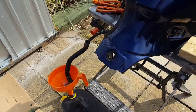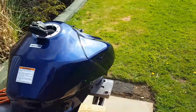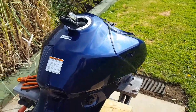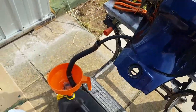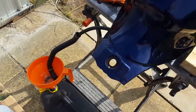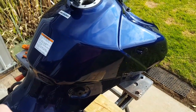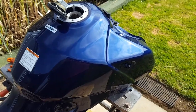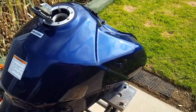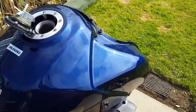Hello Springer Beck, day two of V-Strom petrol tank de-rust. I'm just draining now the phosphoric acid solution that was in the tank overnight. It's half past nine in the morning and I put this in at five o'clock yesterday evening, so it's had plenty of time.